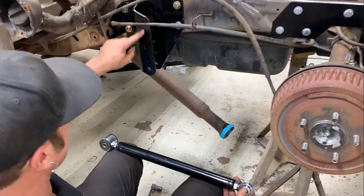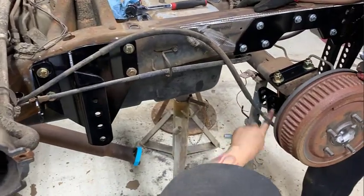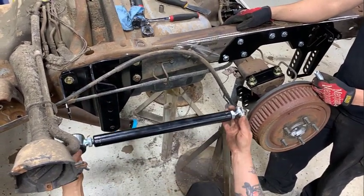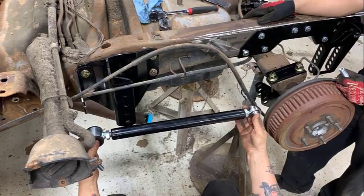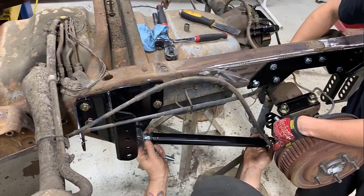We're gonna start in the middle of the 5 holes on the front. There are 3 holes of adjustability on the back. We will start in the middle there, and we will not do final adjustment until the bed is on, the wheels are on, and all the weight is here, because on a loaded suspension, you want these arms to be parallel with the ground for best performance. And also grease zerk down so you can grease the suspension.